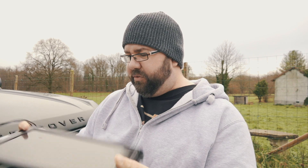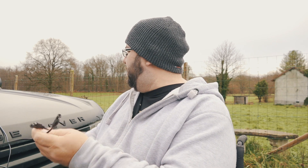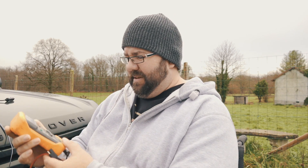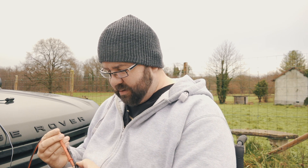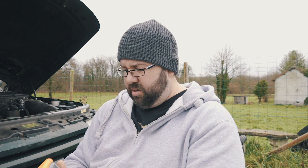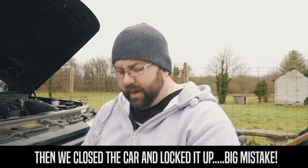So, just a ring solar panel. I'll sit that on the bonnet here — that should be picking up some voltage. I'll get the trusty multimeter out, switch it to voltage and switch it on. You can see that — 20 volts. 20.6. So really, that should have been charging the car.